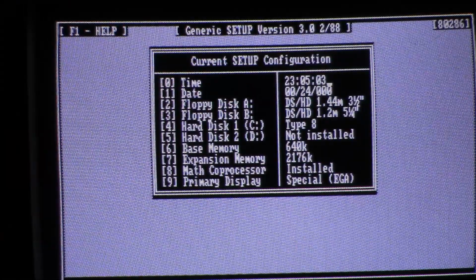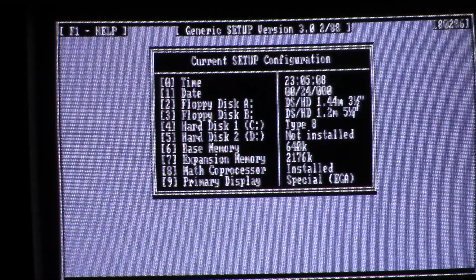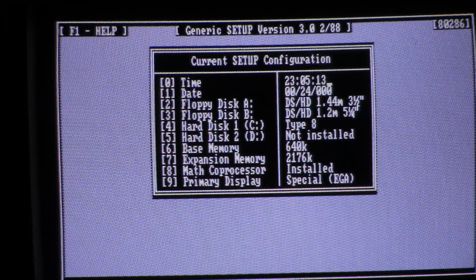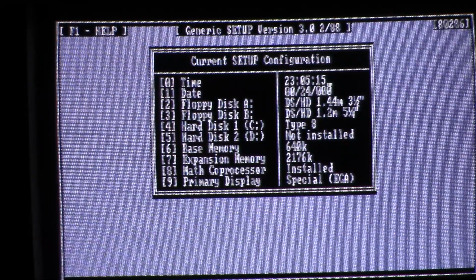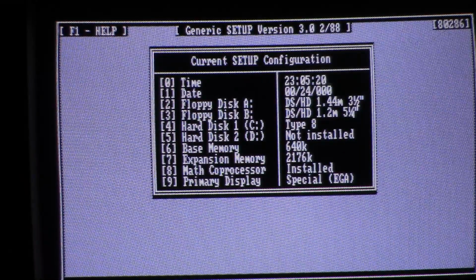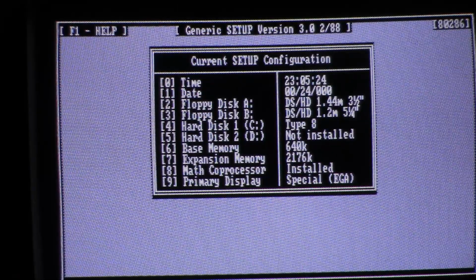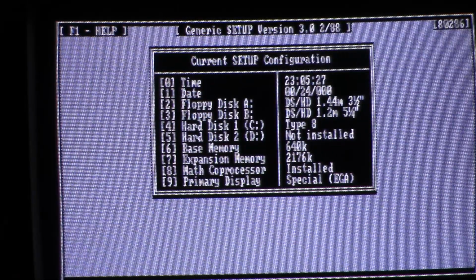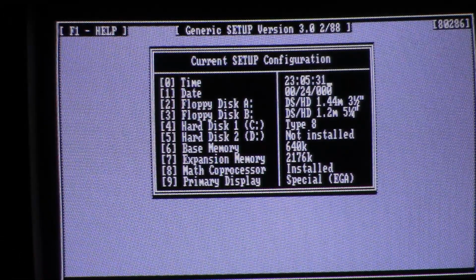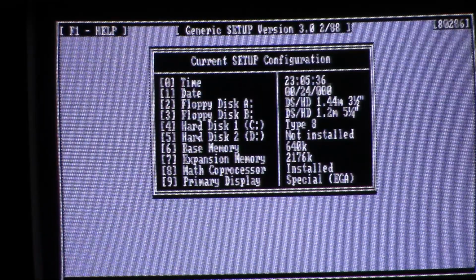Alright, so I disabled the command line that was running that software for the expanded memory, the EMS, and I've rerun the setup program, set board for the Intel Above Board, and I set it up for extended memory. Now, because this is a 286 at 6 or 8 megahertz or over, I was able to do the automatic setup, and now I'm going into the setup program, because, you know, IBM demands if there's any changes to the machine at all, you have to rerun the setup program.